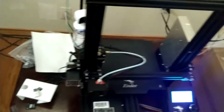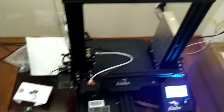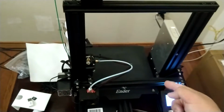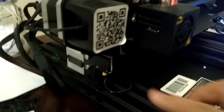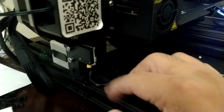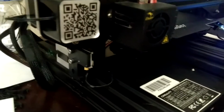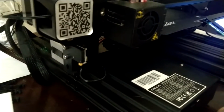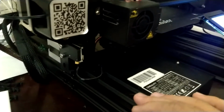So, first thing that's obvious is the 3D printer itself. This is about 220 something bucks. It's the Ender 3 Pro model. The Pro model has things like a magnetic bed, redesigned Z limit switch, which is a pretty big deal because this is a main failure point for people new to the hobby. They set them too high and you can't level the beds ever, and then they go to Creality, and tech support's kind of hard to get into contact with. So this is the recommended printer for newbies.